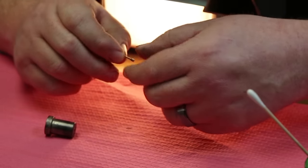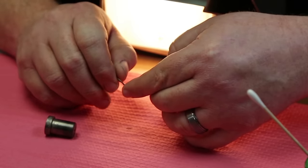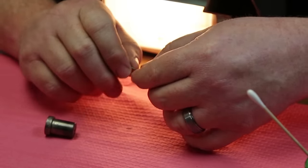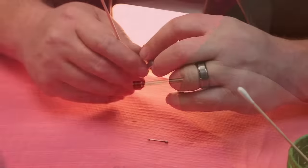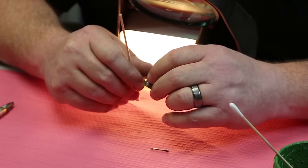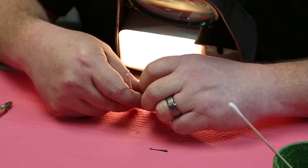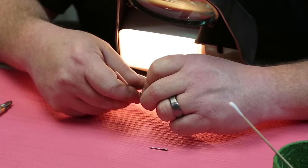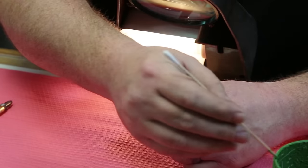Believe it or not, and I don't know if we'll ever be able to demonstrate it on camera, it absolutely cleaned and polished that seat. And you can see after lapping specifically where it's seating. The hard thing to see is the seat down in the holder, but I can see a ring of contact in there as well. Kind of like when you lap a valve, you pull it back out and look to see what you've done, and I can see that it is shining up that seat. We're going to give it a little more.